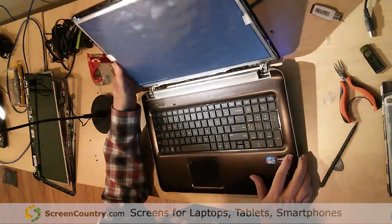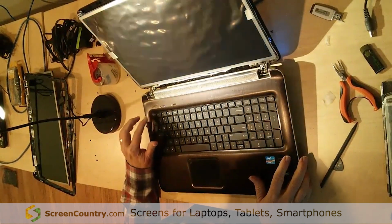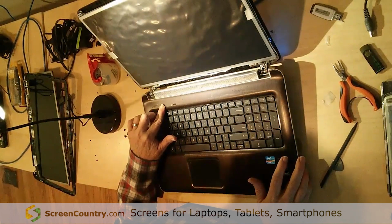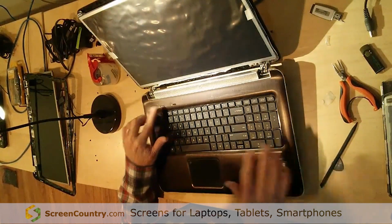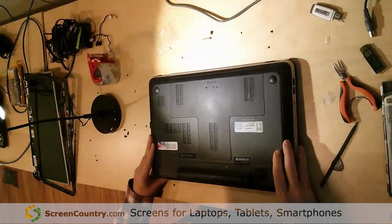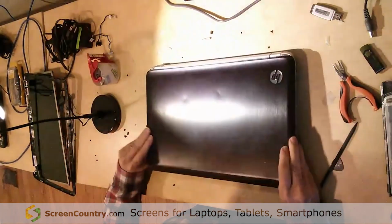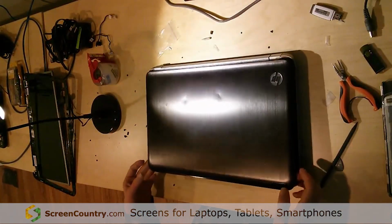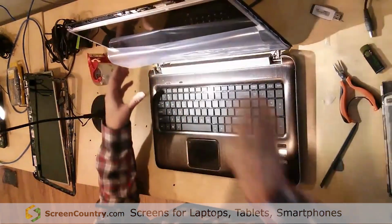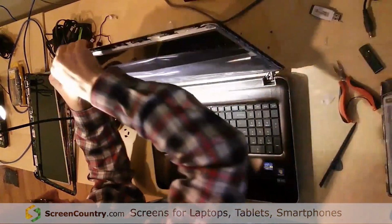All right, I don't know if you can see that on the video, but you press escape for startup menu. Okay, that's good. So now I'm going to turn it back off. Pop the battery back out and finish the job. Remember, we got to pull these up here because we didn't screw those in. And the reason I do the testing there is because if something's horribly wrong, now's the time to know it before you put the whole thing back together again.